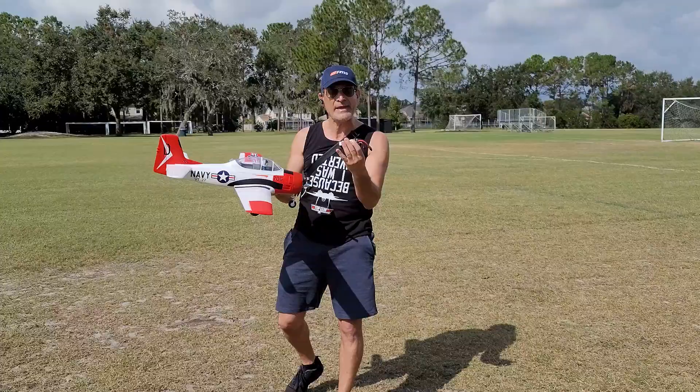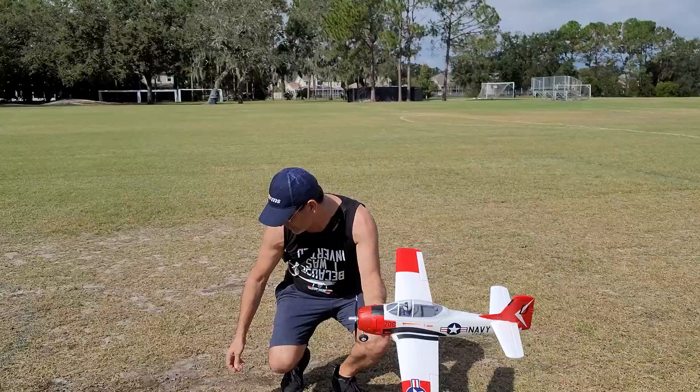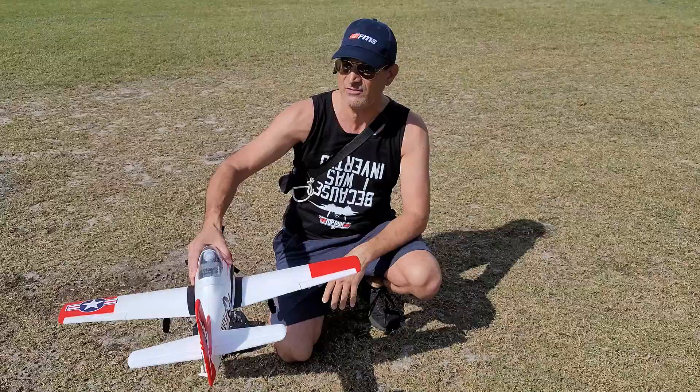I want to see if we get the most performance we can using China Hobbyline on the 1300 pack - it provides a little more weight and obviously it's got quite a C rating. I also boosted the performance - I went into the timing and bumped it up to high timing so we're getting a little more kick out of it. I did the same thing with the P-51, and we'll see how it does off the grass.